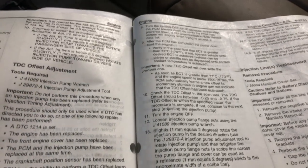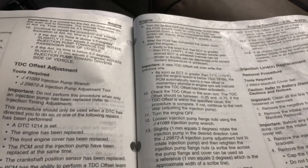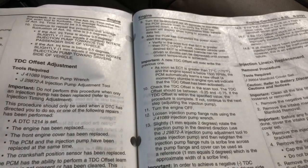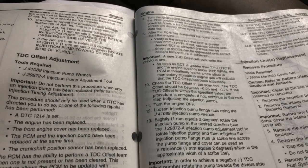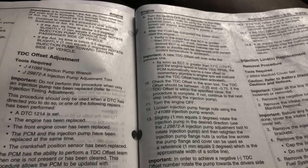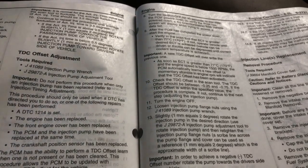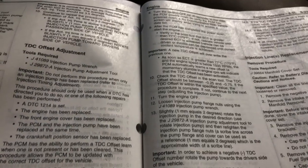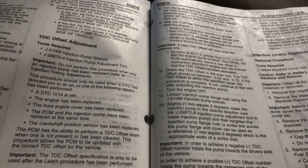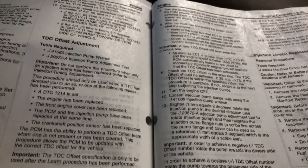The symptoms I had before I did this, about 2 days before we did this procedure, we started to get some lurching, where the vehicle would just lurch forward about 200 or 300 RPMs, and then it threw that code. It ran a couple more times later that day, and the code cleared. The code automatically clears after 3 successes without a fault condition. Then on the second day, we got it again, 2 back-to-back lurches, and it threw the code twice. So that's the point that I decided on the 3rd day to do the video you just saw here.